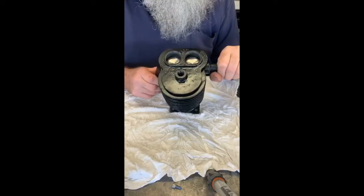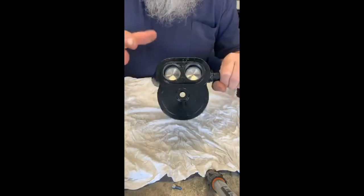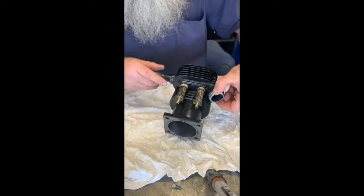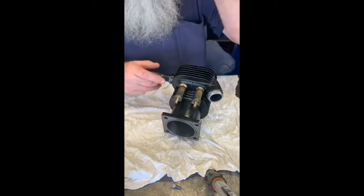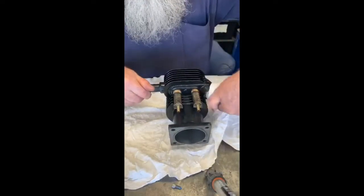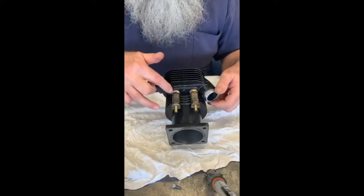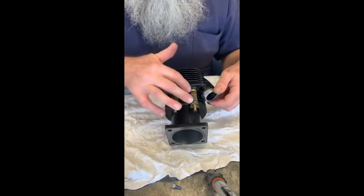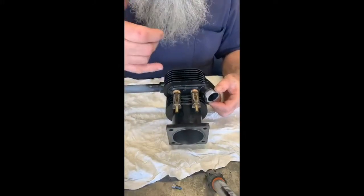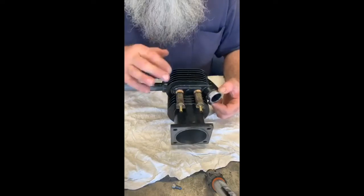The seats have been put in by the wonderful Ray Abbott and his son Jase. I'm holding the inlet tube where the carburettor goes. You can see the blank valves not yet trimmed, the guides, the springs, and the keepers. They haven't got collets — they've got a washer and flat plates with a slight notch, and you cut a 2mm slot in the valve, compress the springs and push the plate through. You could actually compress those springs with your fingers, they were that weak, which is generally the case with most of these early motors — they did it so you didn't pull the heads off the valves, since the valves weren't made of anything particularly great.